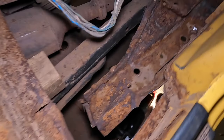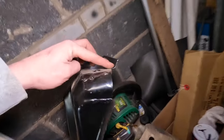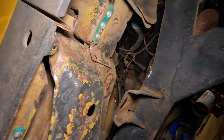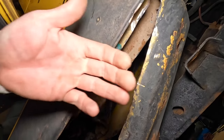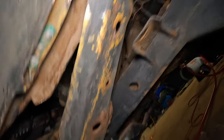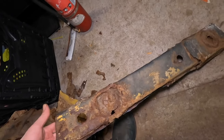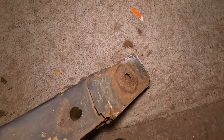All we have left in the front is this torque box, attached right up on this seam. This is my new torque box and this is the one little seam where it's still attached. We've got the Sawzall and the grinder going but it does not want to let go. You can see the inner portion from the inside at the kick panel. Here's the piece we took out — it was brutal. That body mount on the passenger side was definitely sunken in, repaired once already, and it doesn't look great.